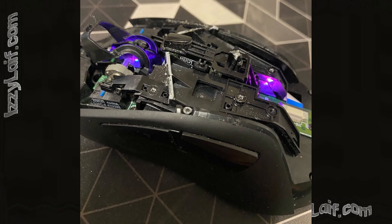At the same time, this lever presses a switch inside the mouse, and this switch is supposed to tell the Logitech brand software installed on your PC that this Turbo mode has been activated. However, this doesn't happen, and the scroll wheel starts to scroll more and skip lines. To fix that issue, you would have to uninstall the Logitech driver and replace it with standard Microsoft Windows drivers for mouse.